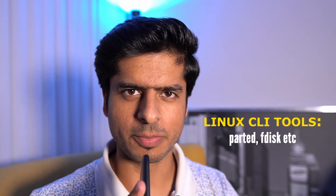Now that we have installed the SSD, there is a fourth step: after starting the PC you will have to format it. If you're using Windows, the most popular format is NTFS. If you're not using Windows, you can use a CLI tool available in Linux. For Mac, I'm not very sure, but I think there would be some software available for partitioning and formatting the disk. Here's a quick look at how I did it with my PC.